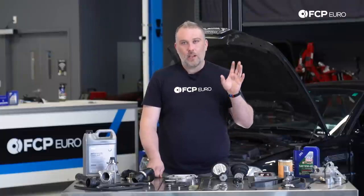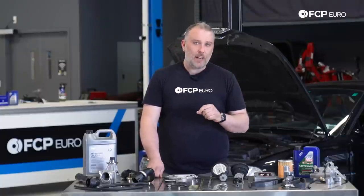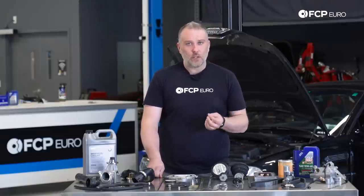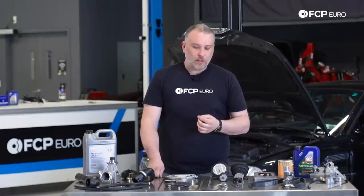It's very strange. There is a serial number for the engine. We do have a pretty good guide on our website on the product pages that talks about this in depth, particularly for the rod bearing service kits, so you can identify which version you have. When it comes to servicing the rod bearings on this engine, perfect time to replace your oil pan gasket, because lo and behold, you're gonna have to drop the oil pan to do it. Also, great time to do your engine mounts, because you have to drop the subframe.